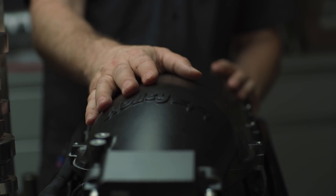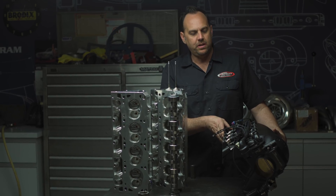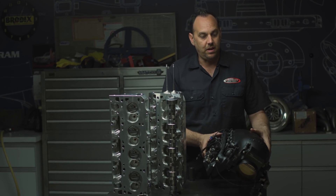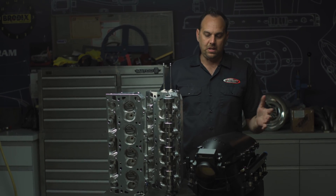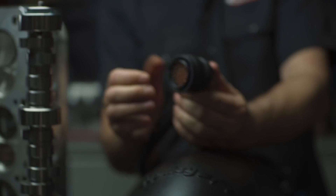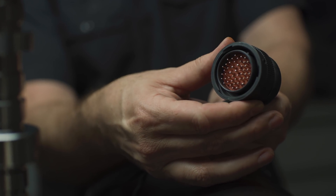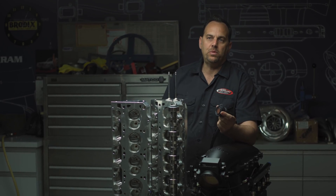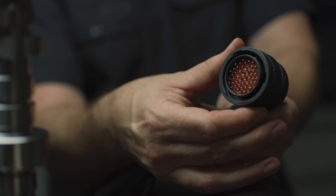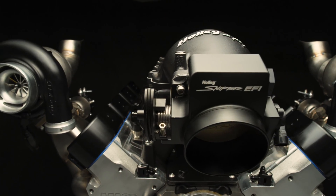For the intake I've chosen a Holley EFI high RAM with a cathedral port style intake and a nice long straight runner. We've got Holley 160 pound injectors and a Holley throttle body — I think it's going to be a good combination for this project. We've put quality connectors on this thing because it's going to see a lot of vibration. The pins are machine pins you can take in and out many times without worry in a race application. There's a lot of things we've engineered into this engine to try to make it work, and we're either going to be crying or laughing — or maybe both.